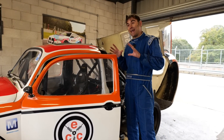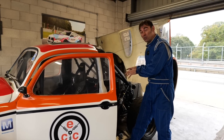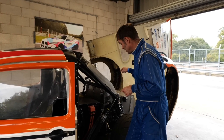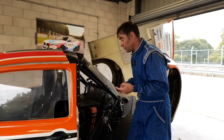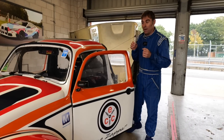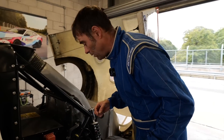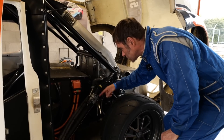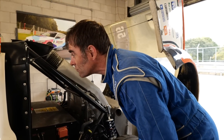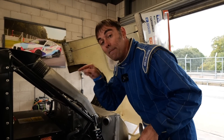Just about to go out again when I noticed a big imbalance between the temperature of the rear motor and the front motor. The rear motor should be doing the heavy lifting and should be the hottest. However, when we came back from lunch, the rear was at 30 degrees — with cooling running through lunch — while the front was at 82 degrees. That may be related to the steering getting stiffer. We've clamped the pipe going to the rear motor, forcing all coolant through the front motor via the Y piece from the pump. It's already dropped to 65 degrees, confirming the front motor isn't getting enough coolant. When we get back to the workshop, we'll probably put a helper pump on the front motor.